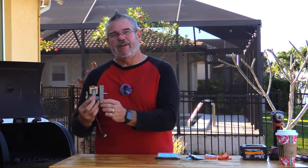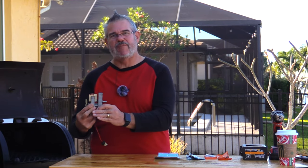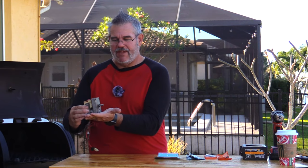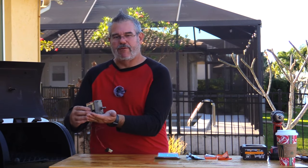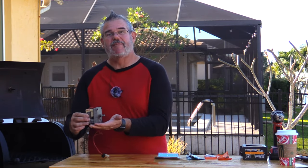What's really interesting — and I'm happy with my Pit Boss — but this is kind of a funny little design thing. This motor is held in place and kept from moving through a small piece of plastic. And that plastic, if it gets hot, begins to melt. The first time it happened, I just took a file, filed it smooth, and it sort of held things in place again. But this piece of plastic or epoxy or PVC — whatever it is — in our case this time got hot enough that it softened and the motor was actually able to rotate in place. Not a great scenario.